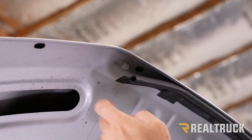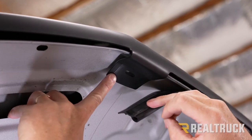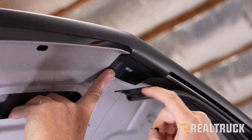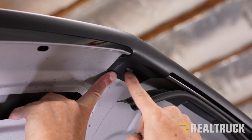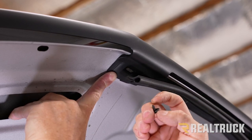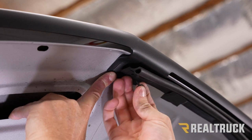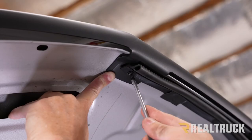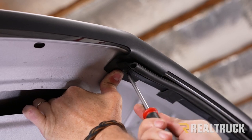Do that to all four of the holes left by the plastic fasteners. Now I've already gone ahead and put the bug shield back in place — the tabs are going underneath the gasket. When you push up, you'll see the rectangular plug coming through the tab. Keep pressure up to trap the tab so that when you put the screw through and tighten it down, the plug cannot spin. The screw goes through one of the included washers — make sure you use the pointy end screws, not the flat end screws — then up through the gasket and into the plug. Before you tighten any of them down, line up all four screws first, then go back and tighten them all up.